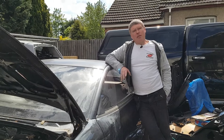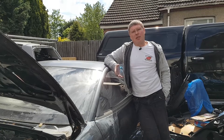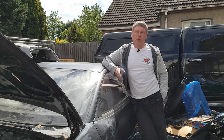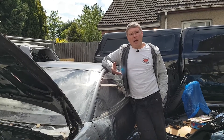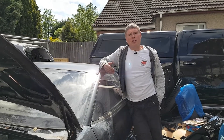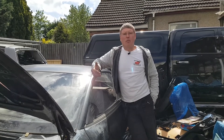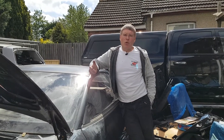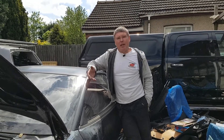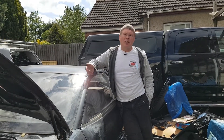It's a bit of a myth that the water causing your cars to rust is coming from the outside, and a lot of you go out and spend an absolute fortune on under sealing your car when actually the water is coming from the inside and causing the rust. What you're actually doing by waterproofing it from the outside is making the problem worse, because any water that may have drained out through certain holes or been allowed to evaporate is now stuck within the car and will slowly eat through from the inside to the outside.